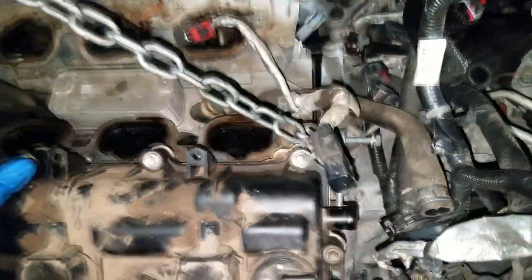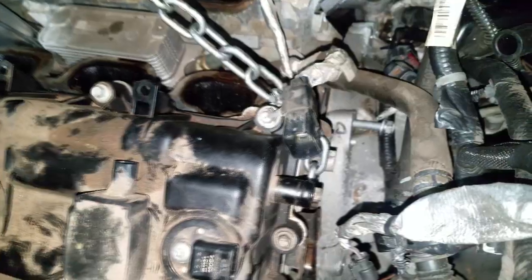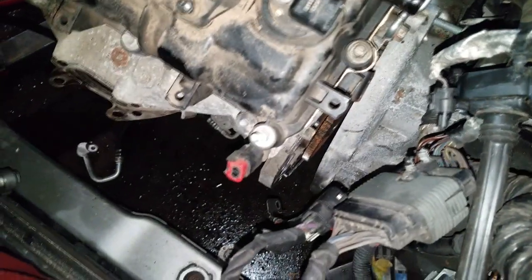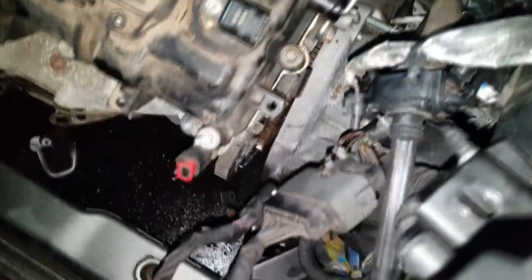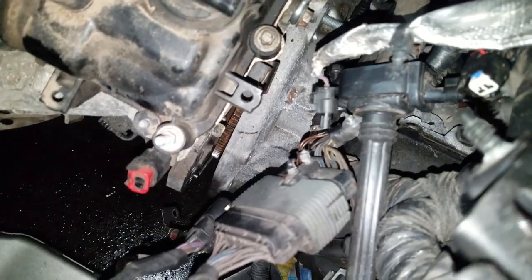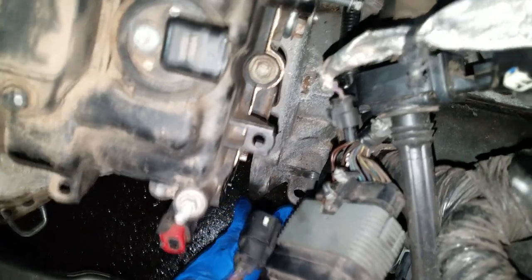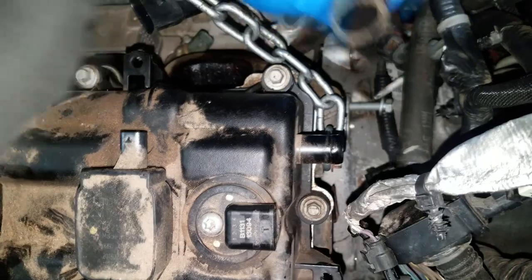All right guys, real quick, let's talk. As you can see, I got the engine — it's not bolted down, it's not bolted to the trans or nothing. I'm sure engine installers know most of this, but I have some beginners on my channel so I figure I'll just talk about it anyway. You have to align the transmission up to the block perfectly, and the way they help you do that is with the use of dowel pins — you see this one right here, and there's one on the other side.